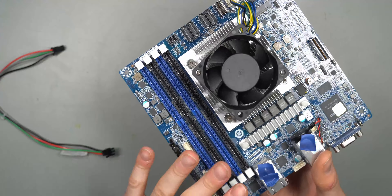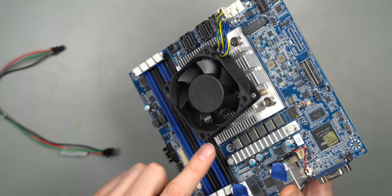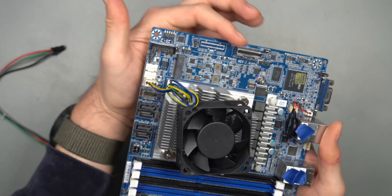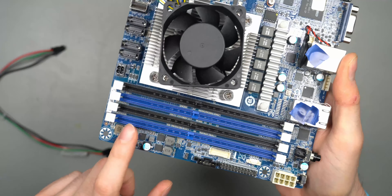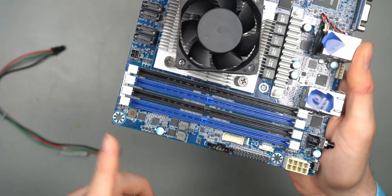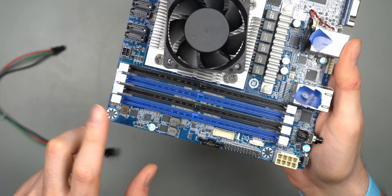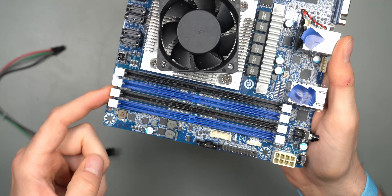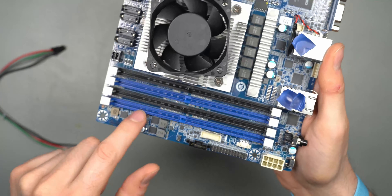Then there's that non-standard little power plug, where you either adapt it yourself or get the ATX variant that already has the ATX adapter included, which is much easier for use with an ATX power supply. This little power cable is for 5 volt, for turning on the power supply and getting status that it's on — pretty easy to adapt. Ramconing's eBay listing also includes a PDF file that walks you through how to adapt it. The AMD EPYC CPU is embedded onto the motherboard — not socketed, so you can't change it out. But considering the cooler is included and the price, I don't think you can go wrong.